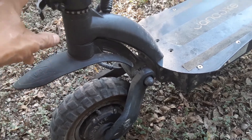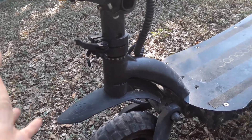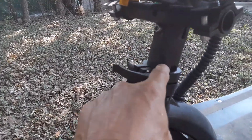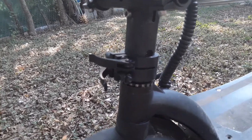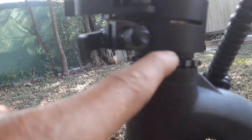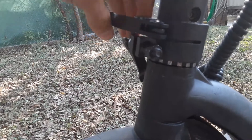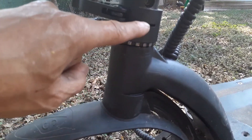After replacing the suspension arm, the locking mechanism ended up cracking, and on one of his rides it completely broke off — the thing just split in half. So we had to order a new locking mechanism. Unfortunately, these are really, really thin. The problem with the new locking mechanism from X-Tron is that, as you're riding, it starts sliding up and up. You have to stop periodically, open it up, push it down, and tighten it back down again — because it just keeps sliding up.